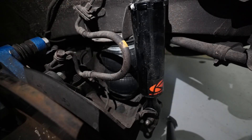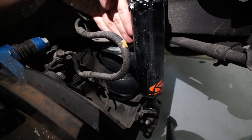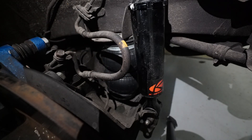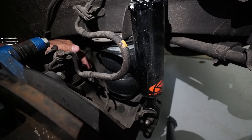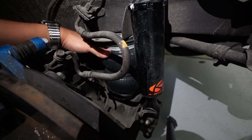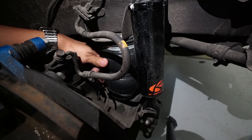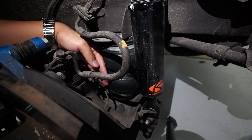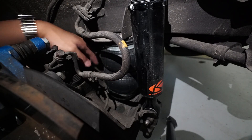Hello and welcome to the rear suspension of the Mazda 2 Skyactiv. Right in front of us, we can see that the suspension type is a divorce suspension layout — as evidently you can see, the shock absorbers are separate from the coil spring, or air spring in our case. We are using K-Sport coilovers. The only thing to note for the rear suspension is that the clearances for the Mazda 2 are actually quite tight — tight suspension, tight subframe — meaning that the airbag has to be specific for this car. We're using what we call the super slim airbags, which are slimmer than our standard slim. These are best used for applications like this where the subframe, brake lines, and the whole suspension have tight clearances.